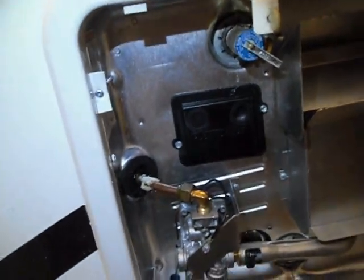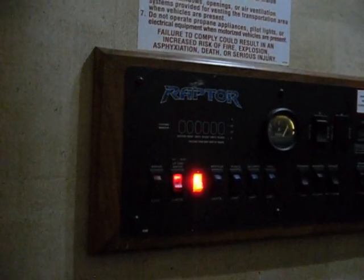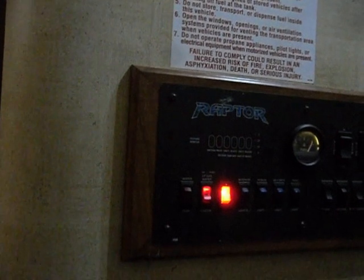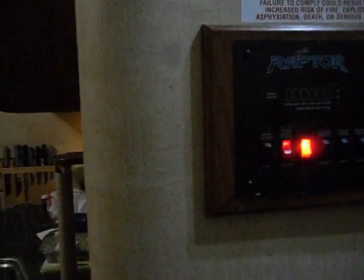I've got a few parts on the inside to finish up. Be sure to check the anode rod - mine was loose, and that's where a lot of the water was coming from. I went ahead and tightened it, then had to redo the urethane because it had been saturated with water. It came up easy though. That's covered in a follow-up video.